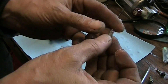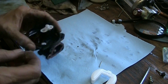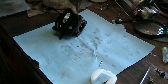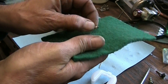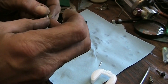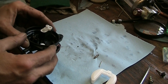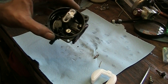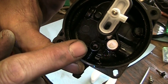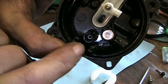I'm going to clean this up - the rubber part of the needle looks okay. It's a metal seat with a rubber needle. I'll get that cleaned up with some Scotch-Brite - the sides should move better now. We'll get a little bit of carb spray on it and blow the crap out with air. What we'll probably end up doing is cleaning up that seat a little bit. I can see it's a metal seat, so I'll use a Q-tip with a little metal polish on it, spin it in a drill, shove it down in there and polish that up.